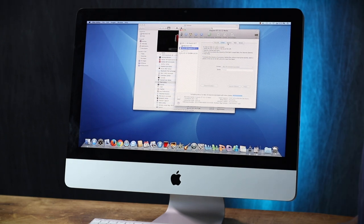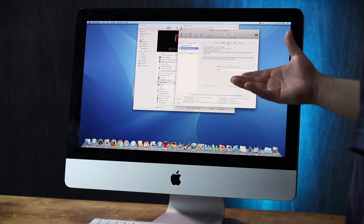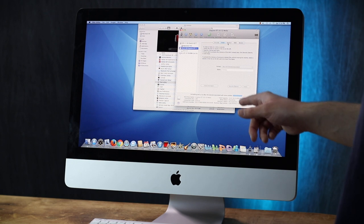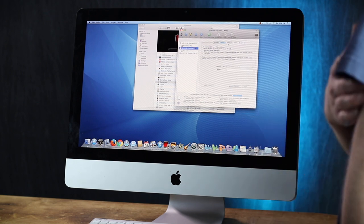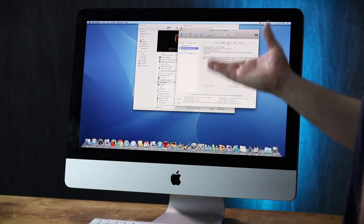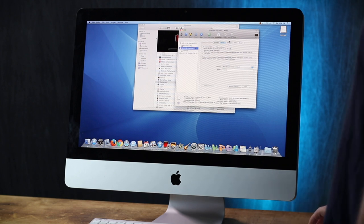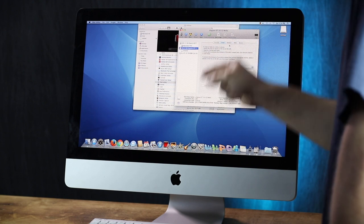It's a flash drive, so it's going to be slow. Plus it's all USB 2. This predates USB 3 on a Mac. So it is GPT, that's what we want because that's the scheme we need to make the flash drive bootable with a Mac system. And then the macOS Extended Journaled is going on here, and then we should be good to go with hopefully imaging this thing properly. I hardly have any luck restoring images with Disk Utility. Maybe I just suck at what I do, but, well, I already knew that. But we're going to try it anyway. If it doesn't work, I'll use SuperDuper because that has never failed me.